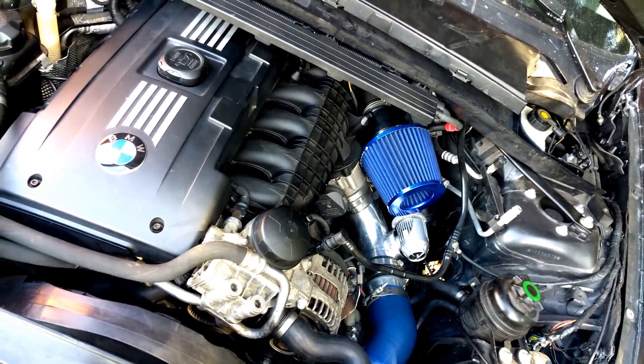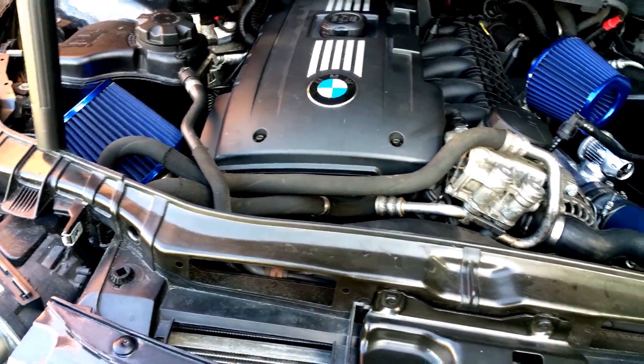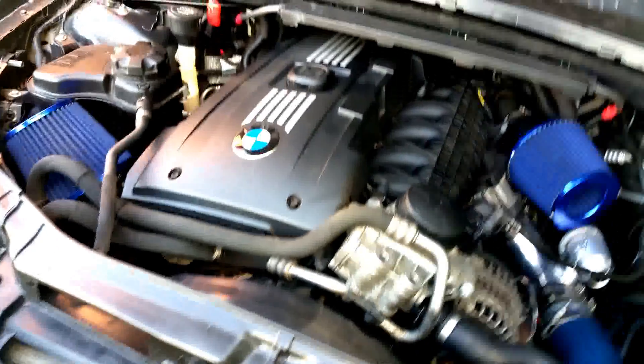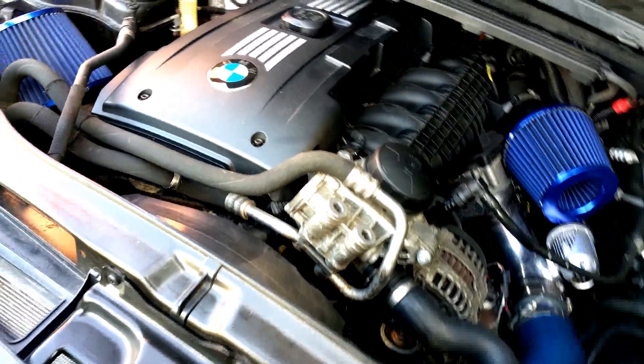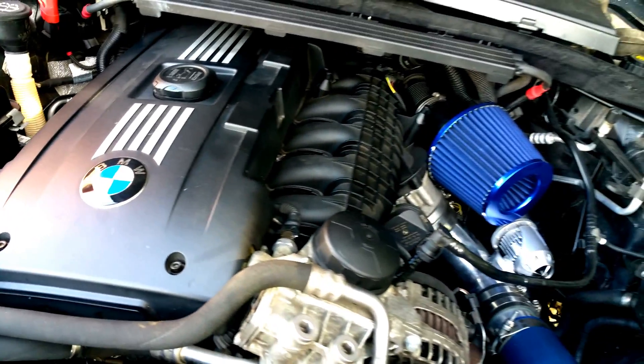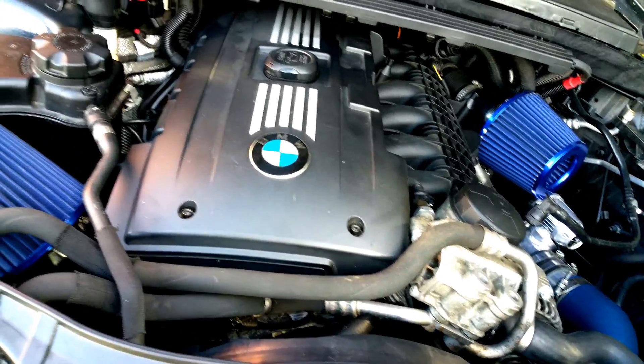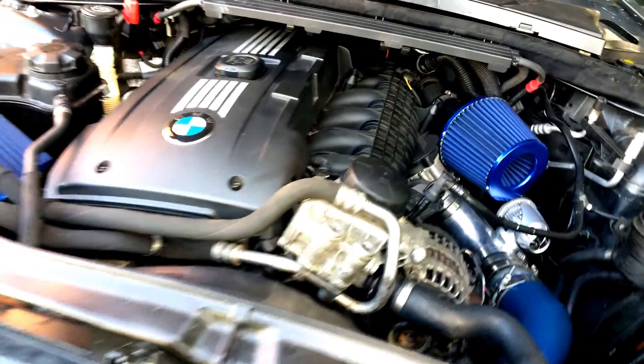That's pretty much the basics for the bolt-ons. You have your intercooler, charge pipe, inlets, and downpipes. Make sure you have good fuel. Then you have your JB4 and your MHD tune — MHD tune is cool because you can actually turn the boost up a little more. Another thing you can do is have a 3.5-bar map air pressure sensor integrated, which is a simple mod to get dialed. That'll allow you to have a little more boost — gives you an extra few pounds of boost. That's pretty much the basics on your N54 bolt-ons.